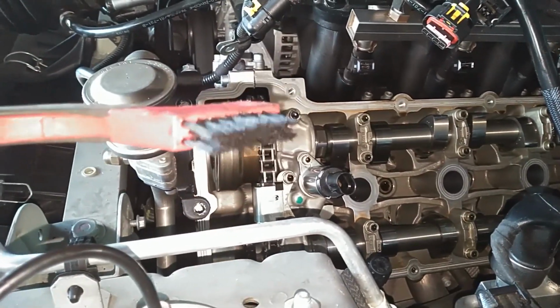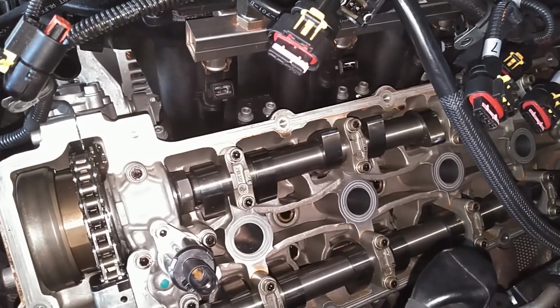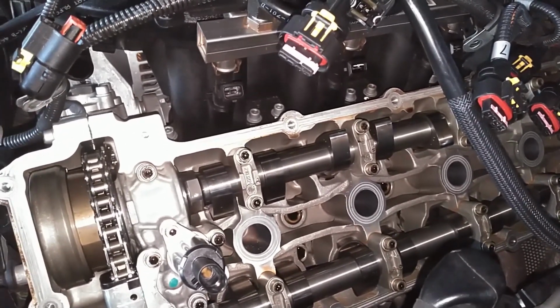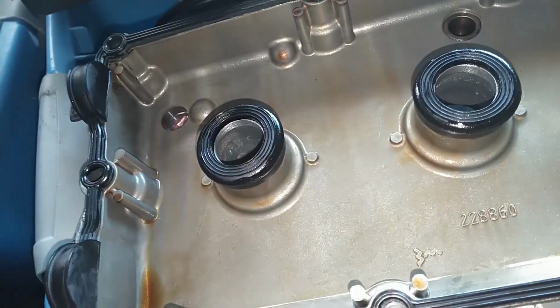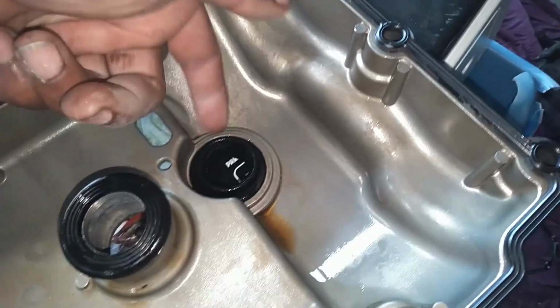First thing I'm going to do is put this cap in place. I lubricated it with oil because I didn't bring my assembly lube, and it's got a part number on there, 229170. Not sold separately. That is on the left side. Again, use assembly lube. Owners encouraged me to use synthetic motor oil. Got this lubed up, set it down here in place. Doesn't have any gasket to go under it. Falls in place like that. Now I'm going to put a couple of bolts in it, and then I'm going to put the guide in here, screw it in there, and I'm gonna put the oil pressure sensor in there, screw it down.